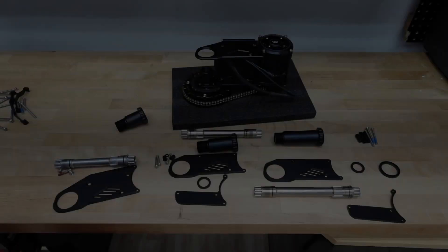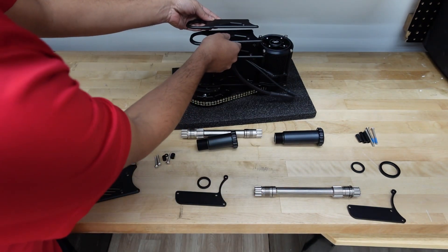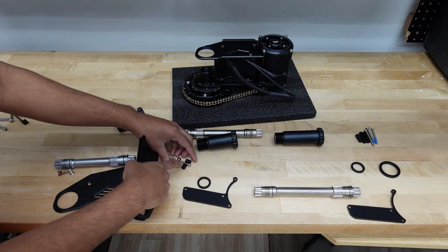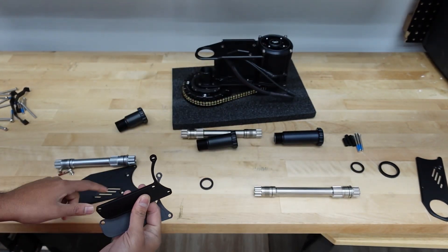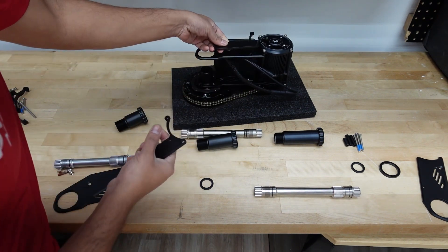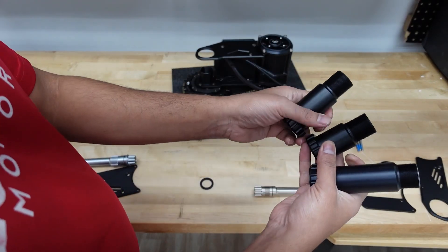Okay, so now I have that out of the way. The left mounting bracket for the 100 and 120 is the exact same thing, so it's going to come out like this. The only difference between these two is the size of the spacers — this is for the 100, and the size of spacers and bolts for the 120. The thickness of this spacer is the same for 100 and 120. This spacer does not exist in the 68 because there's already a spacer over there. So basically what we're going to do is bring this mounting plate out and the spacer is going to take the place for it — this is the same in 100 and 120.